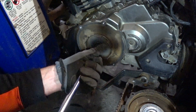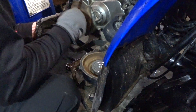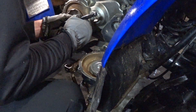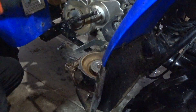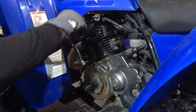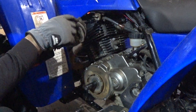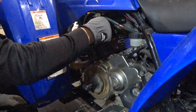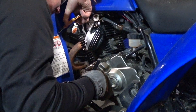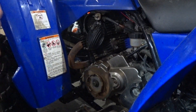The T has disappeared. That's F — T was right after it. There's the T, right there. And there's the line. Take this cover off here so we can see the valve timing line. There's a line there; we've got to go around one more turn. There — that's top dead center. That's perfect where this is right now.